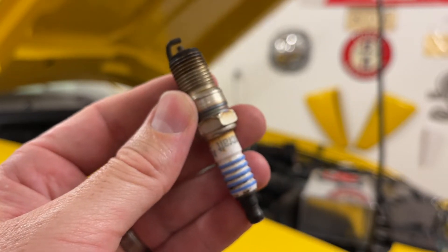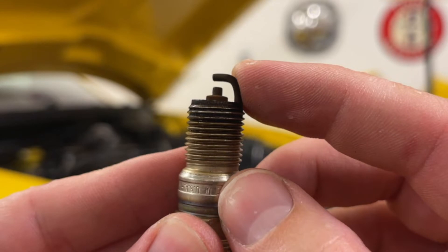That could cause a misfire just from your boost pressure. Something else to pay attention to on the plug itself is if you look at how gummed up it is from the car running rich, or it might be bright white from the car running lean and burning the plug. The plug itself can be fouled up from too much carbon buildup, or it can be destroyed from too much heat. So looking at your plugs, you may be able to tell what's going on in the engine, and that damage could definitely be causing a misfire.